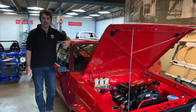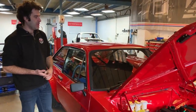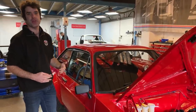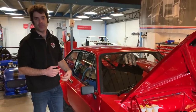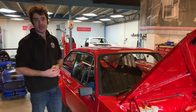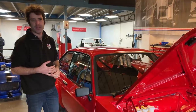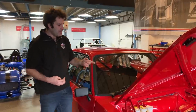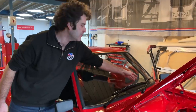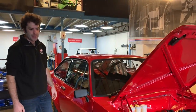We've also looked at making it more usable, so we've got all new glass in the car — heated windscreen and rear screen, all controlled by the PDM, so it won't drain the battery and will only come on when the engine's running and above certain voltages. We've done a whole new heater matrix, controlled so we can manage the temperature and fan speed — all variable. New wipers go for the modern flexible blades, so in a crash or pedestrian strike they'll flex and move. There are quite a lot of modern features and thinking that we've had to put into the car.